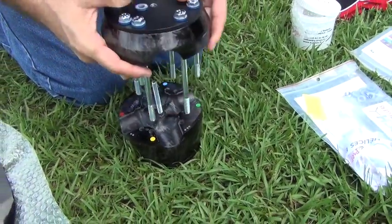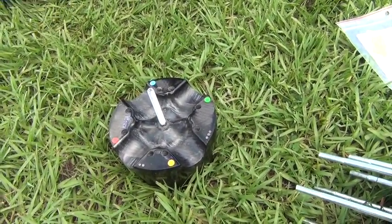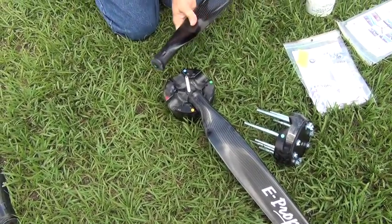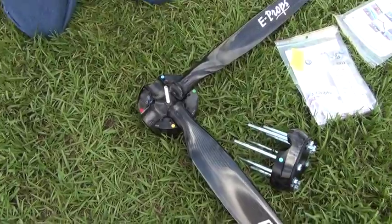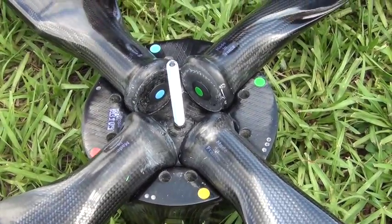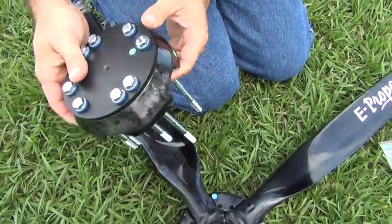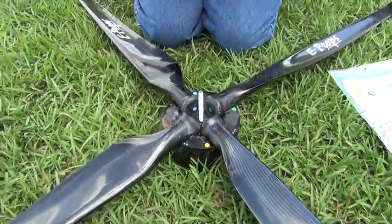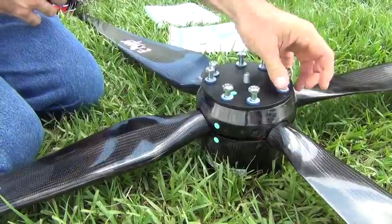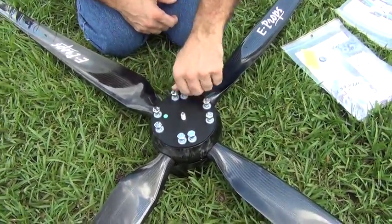So we pull this apart, and now you see the colored dots that we're going to use to line up the proper blade with the proper position. Here's the yellow, so we'll put the yellow in, then we'll do the green. There's our red and our blue. There is a blue dot that goes here, here, and then we have to find it on the outside, which is here. What all this is about is dynamically balancing the propeller — these are dynamically balanced at the factory — and we want to assemble it basically the same exact way that it was balanced at the factory, so that they're completely ultra-smooth.